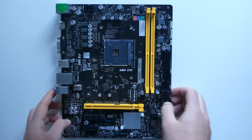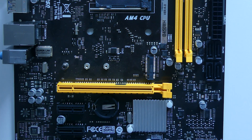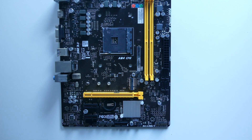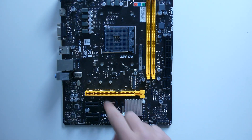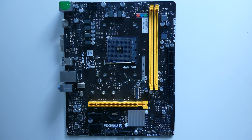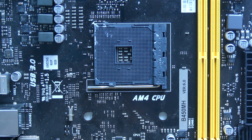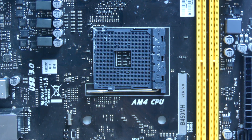You can probably immediately tell this motherboard isn't the highest end — only two RAM slots, one full-size PCI slot, and some pretty basic VRMs. One thing I'm noticing is there's no AMD backplate, which is quite important if you want to rest a stock cooler on it. That's okay because I have one personally. Also, there's no IO shield and no CMOS battery, so you'll have to source replacements. Another thing to note is there's quite a lot of thermal paste on the CPU socket, so I'm going to go clean that right now.